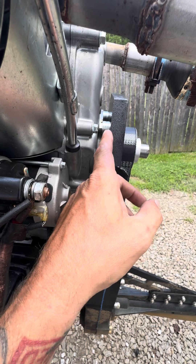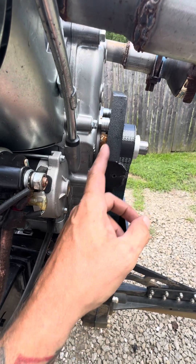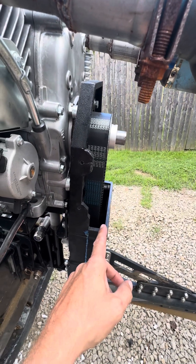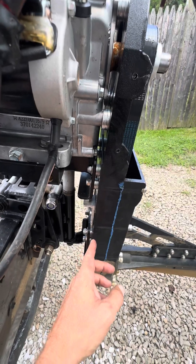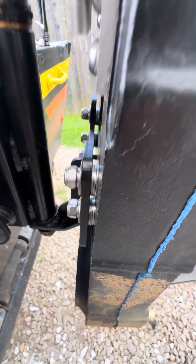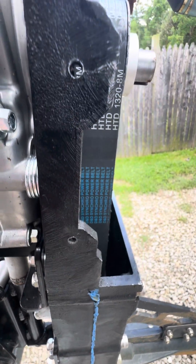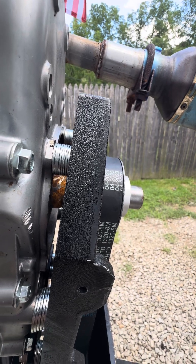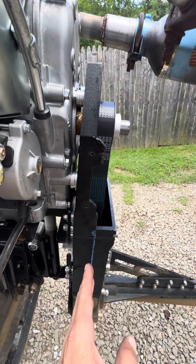What I did — you can see — I just added washers. I got longer bolts for up here and added washers, thicker to smaller as you go down, just to move it away from the engine. This belt just wants to walk and rub on the front of the case. So I moved it out like this and ran washers all the way down to keep it away — the lower you go, the fewer washers there are. That kicks it out and makes the belt run as true as I can get it.